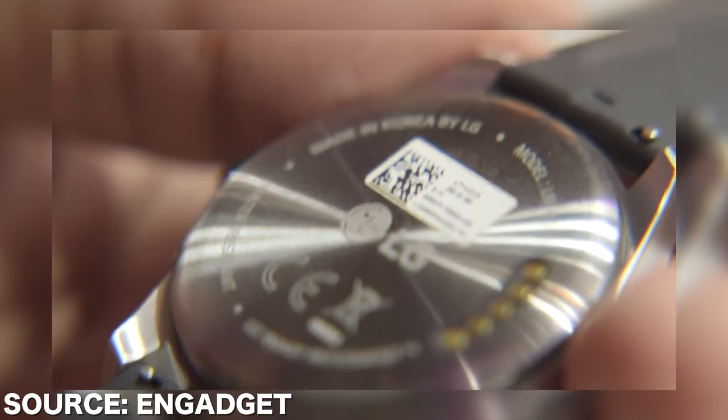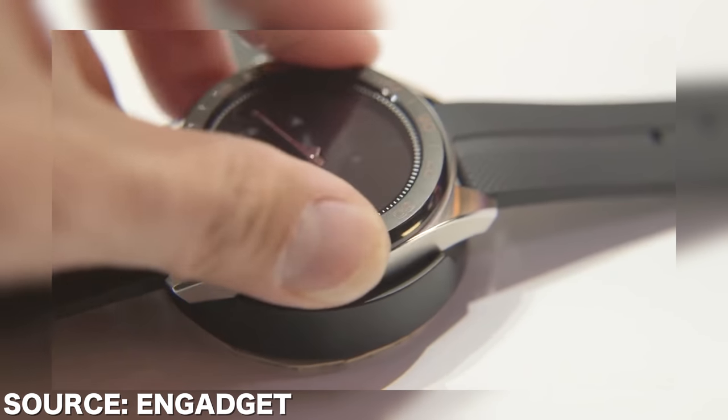You'll notice on the back of this watch there's a giant metal plate — that means no inductive charging. They're using the old method of five gold pins, which I remember from when I reviewed my Fitbit Blaze. Inductive charging — like on the Galaxy Watch or the Apple Watch since day one — means you just place the charger on the back of the watch and it starts charging as long as they're touching. With pins, you have to align all five exactly right before it'll charge. The only reason companies ever used pins instead of inductive is to keep costs low. I understood it on the Fitbit because they were aiming for affordability. But if you're charging $450, I really don't know what the excuse is.